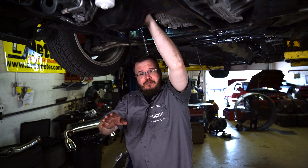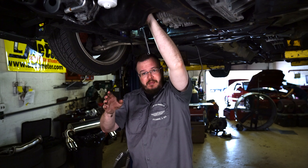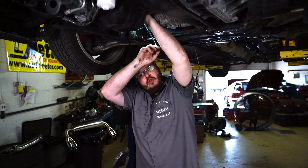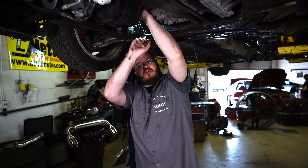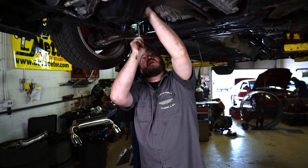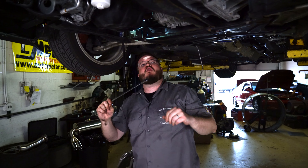We got that 14mm off the black bracket that secures the turbocharger to the block — that was a bit of a bear. Now we've got a 10mm for the oil return tube that comes from the turbocharger and drops in right above the pan. This is pretty easy to get to with one of our favorite little swivel wrenches.